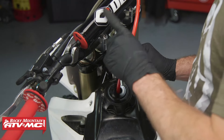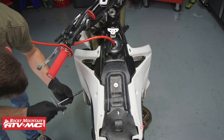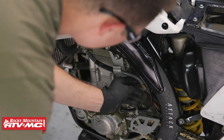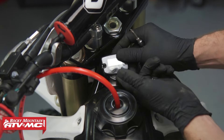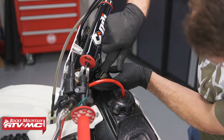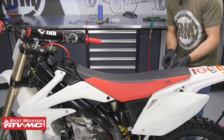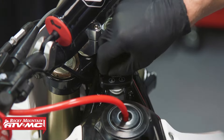With the gas tank on, we can now install our meter bracket under the top mounting bolt. Then we'll reconnect the fuel line. Now we can take our meter and use the two screws that came with our new bracket and put those into place. The last things we need to do are install the puke tube and reinstall the seat, then go ride. We'll also install the plastic clips that came with the meter — those just keep debris and mud out of the screw holes.